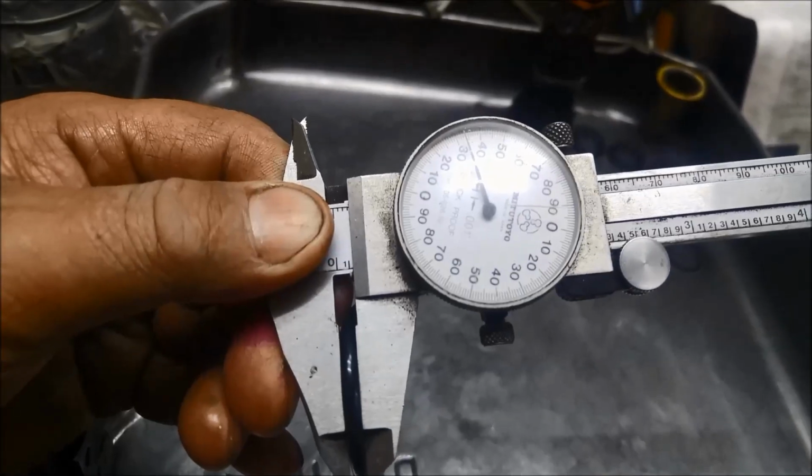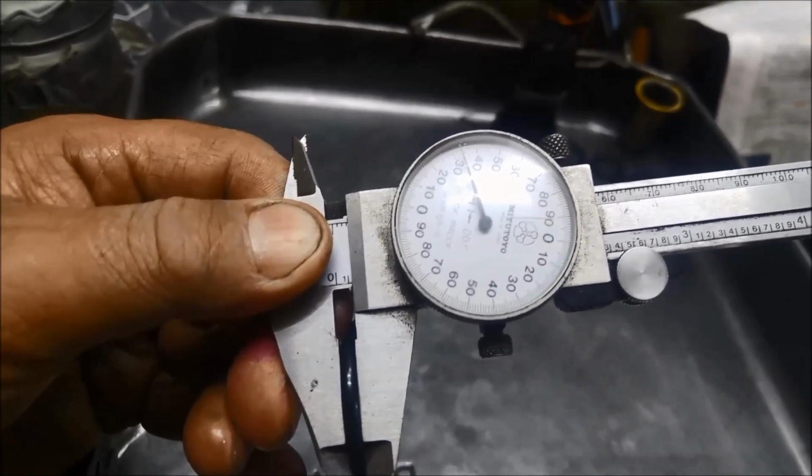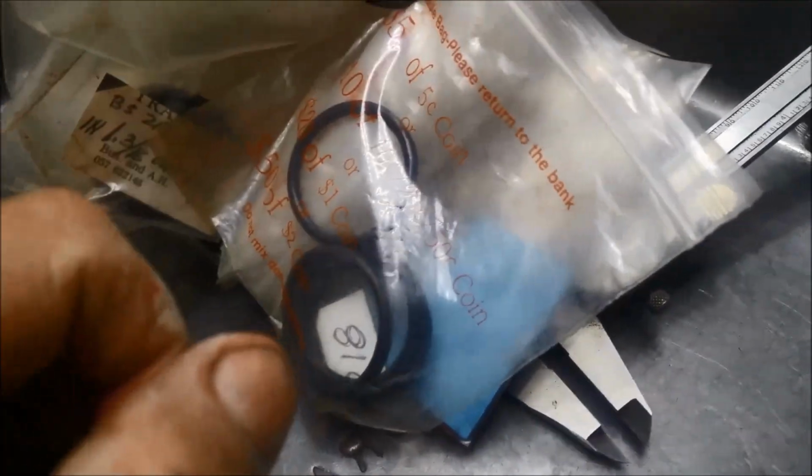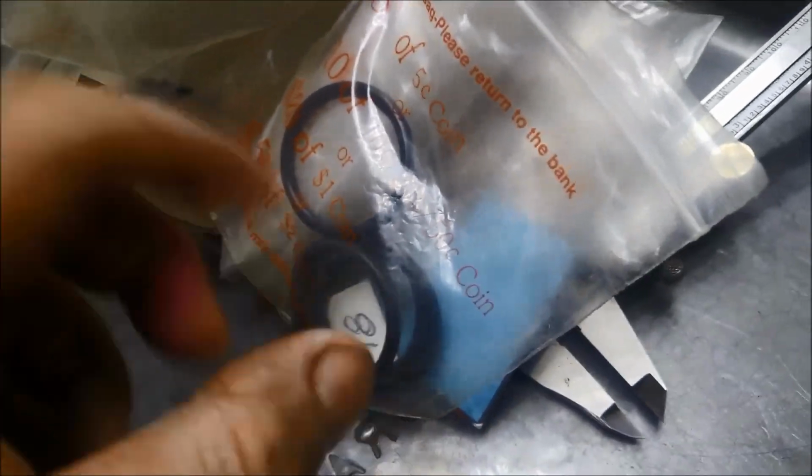Now I can get that O-ring off, and I can just manoeuvre it down over these little connections. I'll just manoeuvre it over all these and get it off. Large seal. It's like a 130 section, 130 thousandth of an inch. The bag supply ones are actually 135 section, so that makes sense if it's flattened out a little bit. So this one's a little bit too big. It'd be impossible to push in if it was a little bit bigger, and this one's just a tiny bit smaller, but because it's 5 thou all the way around thicker, even though it's a tiny bit smaller, you can hardly see it.